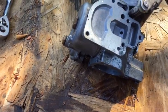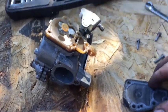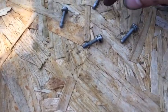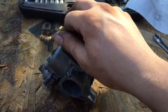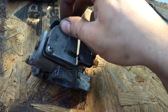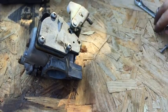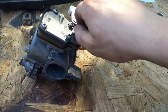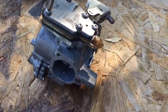I don't think there's going to be any issues with this thing running as-is. I would recommend going through and buying a carb kit — put in new seals and new gaskets, because it will run better. Also watch your screws — these all look about the same length, but make sure you note where they came from in case they're different lengths, so you can get them back in the proper position. And make sure you have a good Phillips screwdriver so you don't damage the screws.